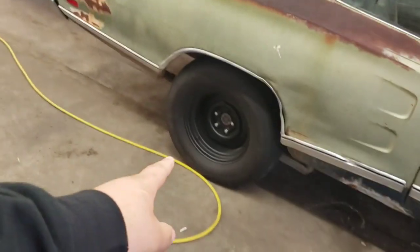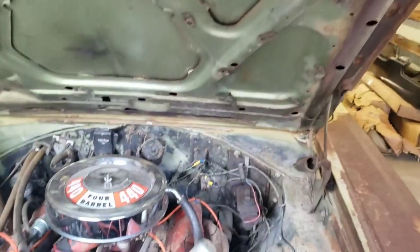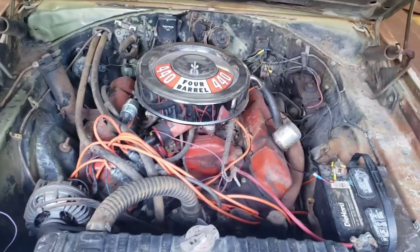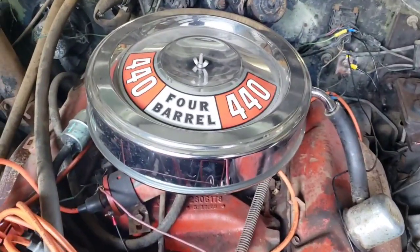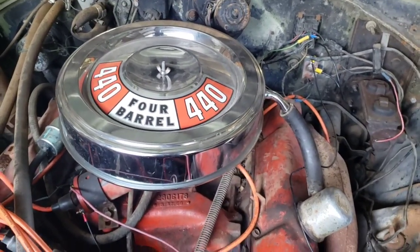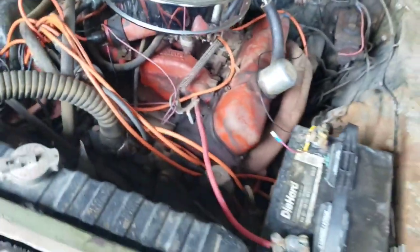When I was loading it on the trailer, we saw the Dana rear end — that's nice. And as I've shown in other videos, if I can get this open — that's not a 383. Based on the air cleaner, you can tell what it is: it's a 440 4-barrel. It is a 68 engine for anybody interested in codes — you can see B440 there. It is a 68.